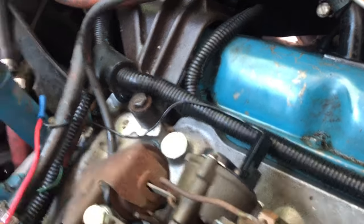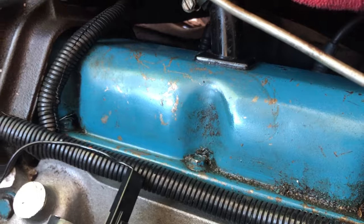That could be where it's coming from — dripping out of the manifold and burning off, because all the oil going into the vehicle is on that side. If we look under here, you can sort of see a coating there. There's a bunch of oil and grime on here, lots of oily deposits on the torsion bar. On the other side, the torsion bar is all nice and dry, everything's dry.